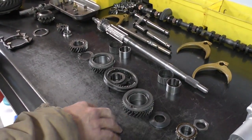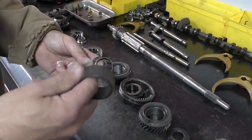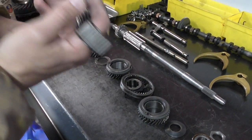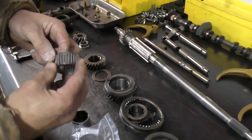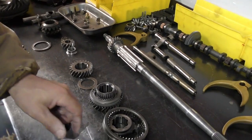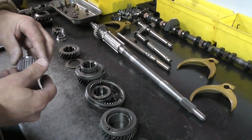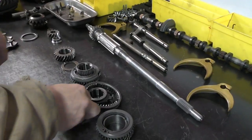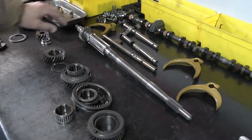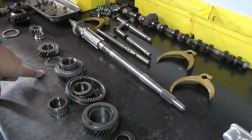Now I've got my synchros back onto the gears, so it's time to assemble the input shaft. I'm going to take these two parts — these are the old bearings with the damaged interior bearing surfaces — and replace them with our new ones, which have a slightly different, stronger cage design. All of this is going to be assembled dry, and that's important. We don't want any oil on the shaft surface at all. Once it's in the transmission the gears will be submerged in oil, so it's not a problem — you just don't want to lubricate it during assembly.